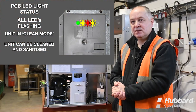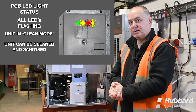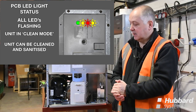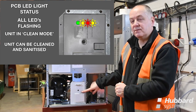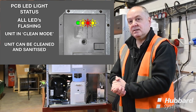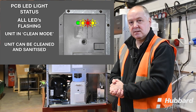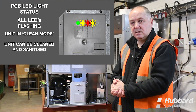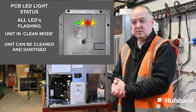With the green light steady and the two yellows and red flashing all together, this means the machine has been put into clean preparation mode. This normally occurs by the reset button of the PCB board being pushed between two and five seconds during the defrost cycle. The machine would then be activated and ready for cleaning in accordance with manufacturer's instructions. To reset the unit, turn the power off for 10 seconds before resuming power, where the machine will pick up on its fill cycle and normal operation.